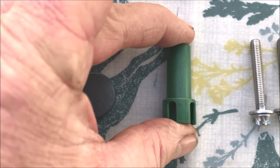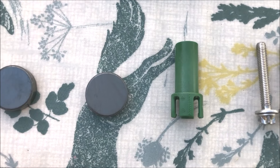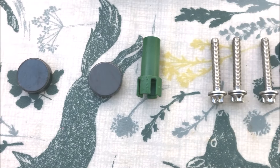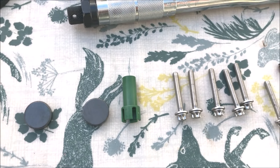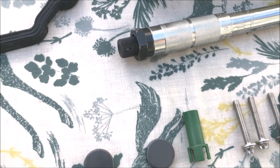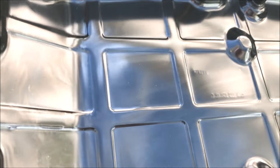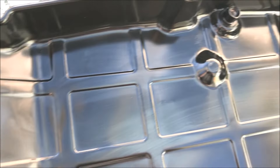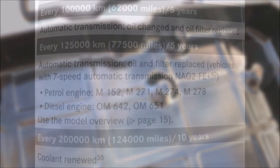The standpipe is a green one — some older ones are white. We have two strong magnets, though when we took the sump apart this morning there was only one magnet inside. This is the sump we took off this morning — we cleaned it up and it's spotless now, but it was really dirty initially, so it was due a change.